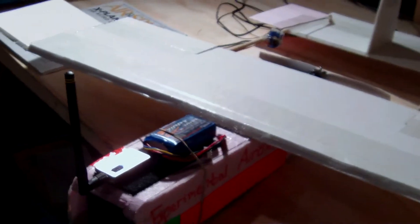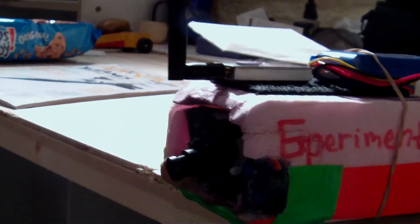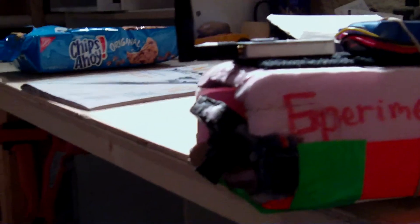This is my third FPV platform. This is currently the RC Test Flight micro drone. I added some things to it — I added some winglets on the tail and out on the edge so it could handle a little bit more weight, because I've done some mods up here. As you can see, I have a tilt servo — no pan, just tilt. I can adjust it with my finger on the knob of the DX8, or I can do it with a switch. I have it set up for both, so I can trim it with the knob and do a quick look down with the switch.